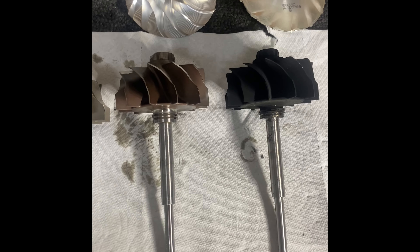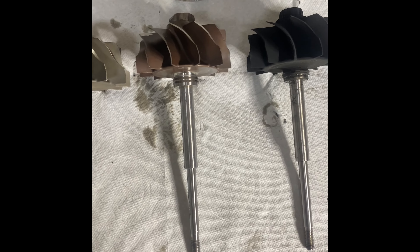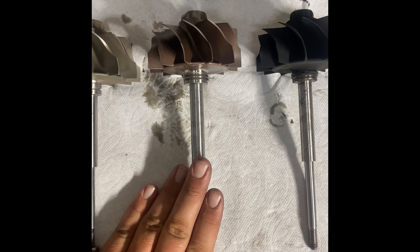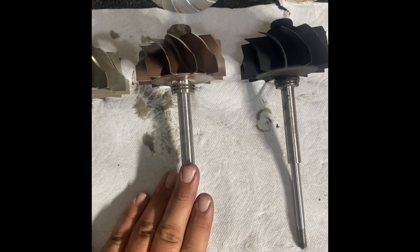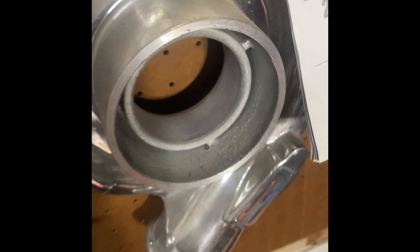The 77-86 is not a T4i, not a T4, not a T6. It is a special Cummins-designed flange, so that housing is useless. The 65-millimeter comp wheel has no MWE. This was a one-off off of an M11 — no MWE — so generally they have low value.